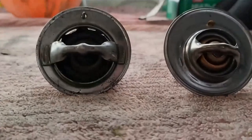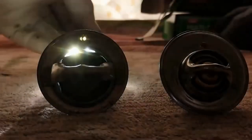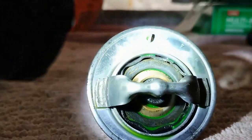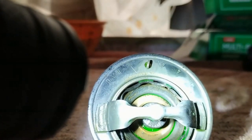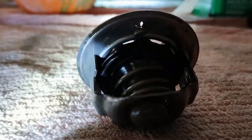There she is — the coolant's down there in a catch can. I'll get the new thermostat in and clean up the gasket. We do have a defective thermostat. There's the new one on the right, and turning on the torch we can see the old one is actually not closing — it's got a perforated diaphragm. It looks like it could have got completely twisted around, and the rubber on the outside is poking back in instead of out. This is definitely a job worth doing.